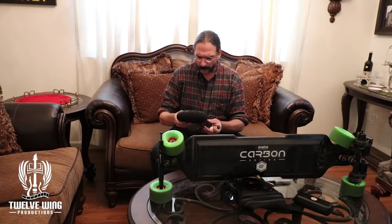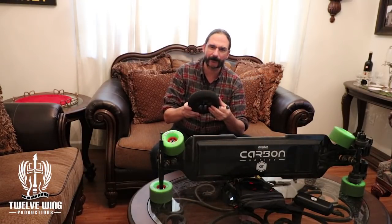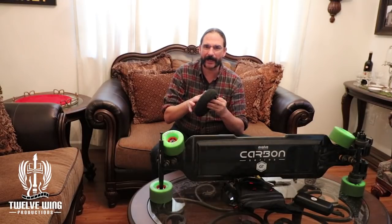This was after — I'm going to say probably 90 miles or so, a little under a hundred miles. I pulled the bearings out because I was getting some clicking, and that was related to how these glass-filled nylon rims allow the bearing to move slightly. The bearing block, where you have the two bearings and the bushing creating a solid mass inside — if the spacer is a different width than the actual space between the bearings, it can cause some shifting between the wheel and the axle.